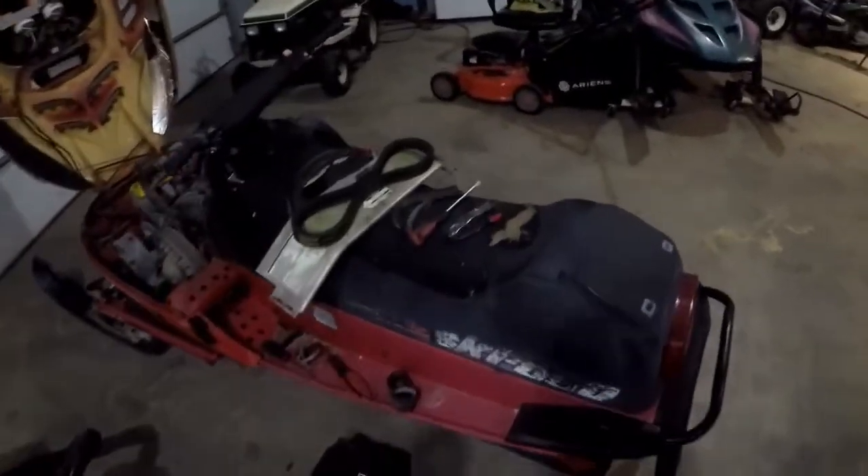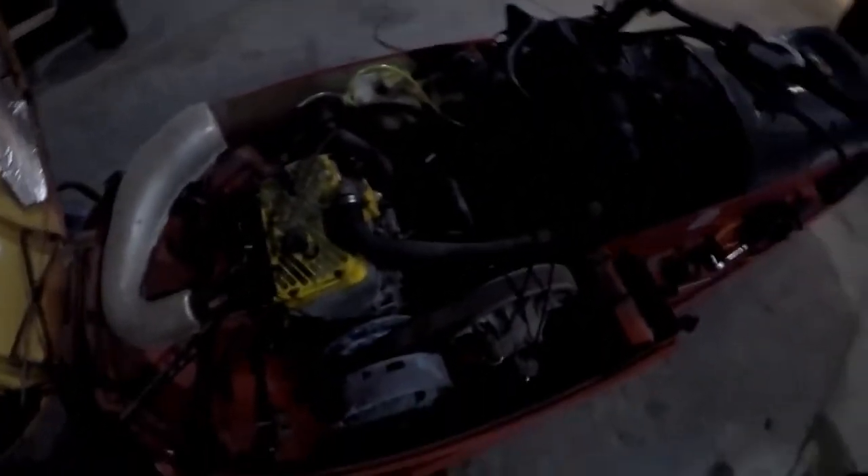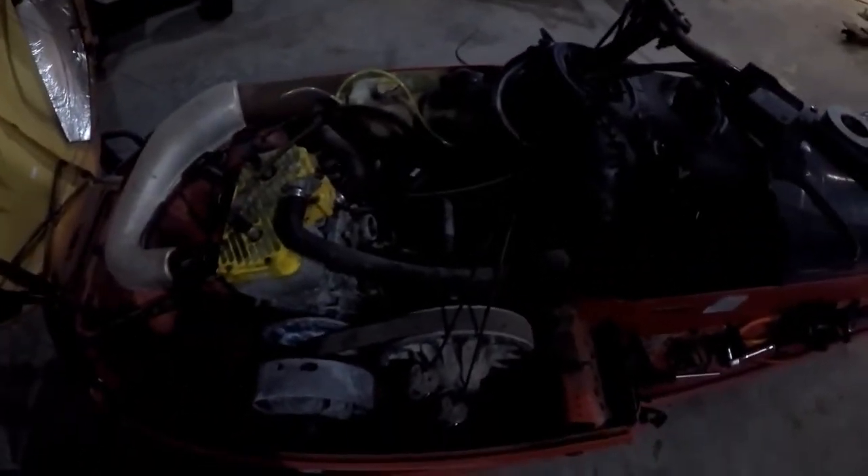Put some tape on the old seat to get that fixed up. The seat looks much better — just a quick and dirty to get rid of some holes; not gonna win a beauty contest but saves it from tearing more. Got one primary fuel line on. The outgoing with the two new ones to the carbs — going to drain the fuel system next, replace the main fuel line first, then finish up with the carb outlets. Also putting a new impulse line on because that thing is rock solid. Put some rags in the rotary valve area since I'm done for the day.